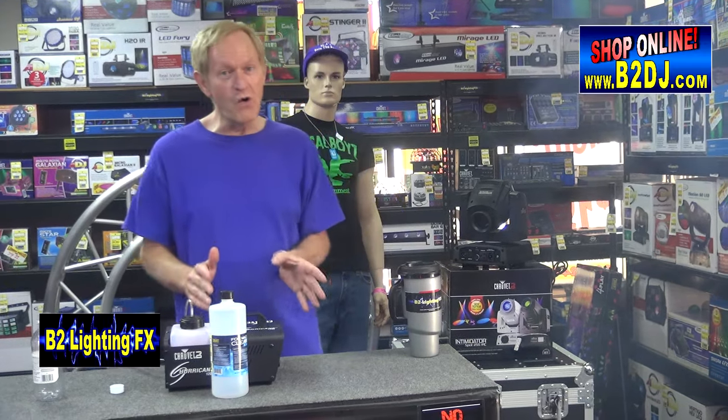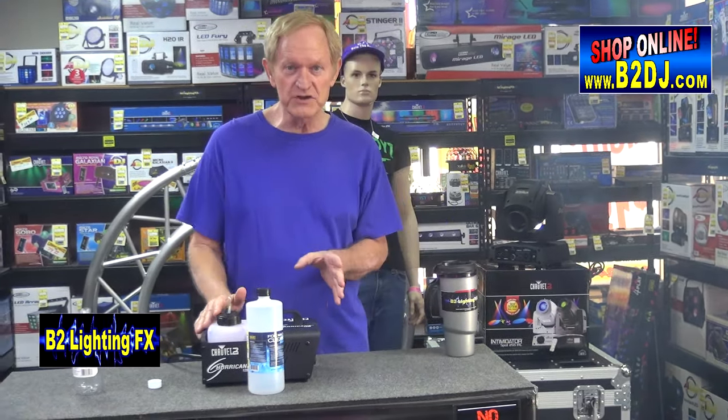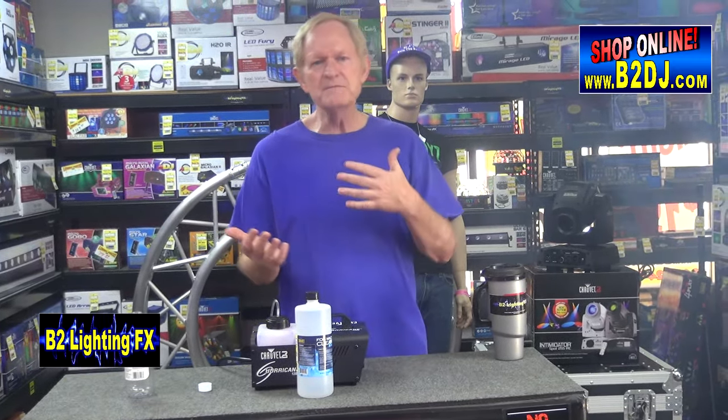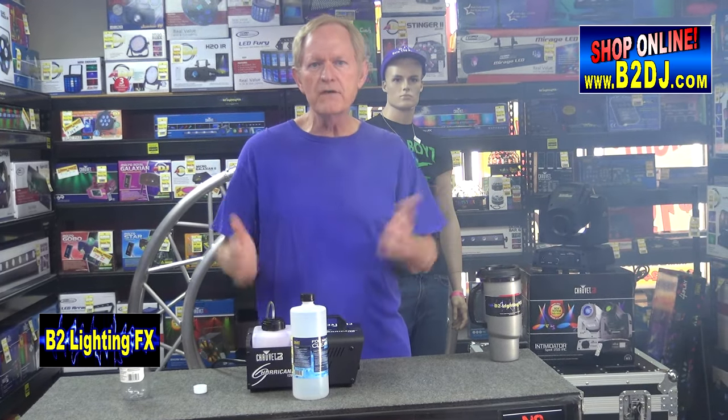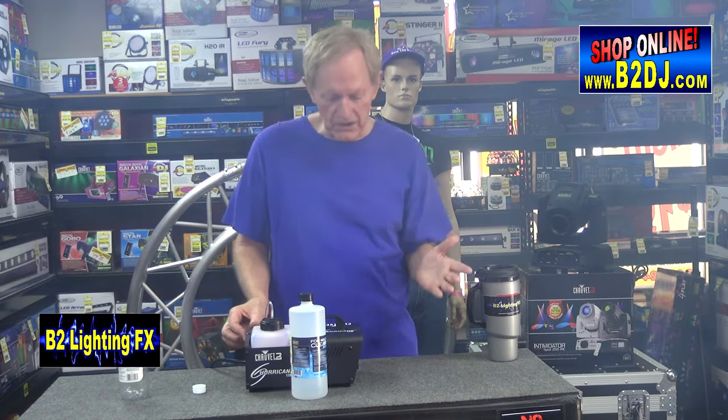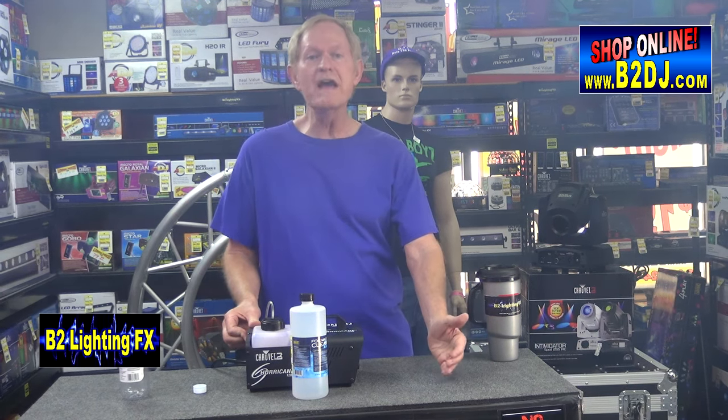Normally it takes a little bit longer to unclog your fog machine. It might take pushing the button for about 30 seconds, then doing it again, for about four minutes total. And if it is going to get unclogged, it'll do it within that time. This must have had a very minor clog because I am really shooting out vinegar vapor.